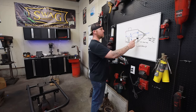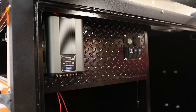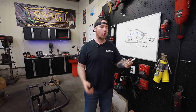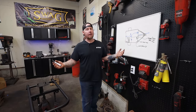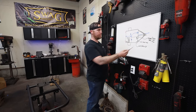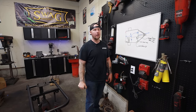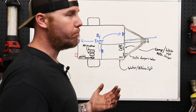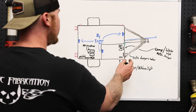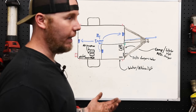We've got a seven-pin connection coming in that's going to go to our DC-to-DC charger. Traditionally you'd have a separate Anderson fitting to maximize charging speed for the house battery off the tow vehicle, but because I have so many tow vehicles I don't want to do that. I'm going to hook up the positive wire from the seven-pin connector into the DC-to-DC charger and throw a small fuse on it so we don't burn anything down. It should just slowly trickle charge. We also have a solar panel on the roof of the rooftop tent, and I'd rather lean heavier on solar than on the alternator anyway.